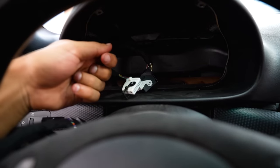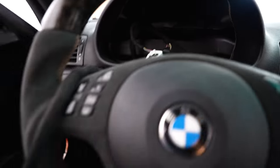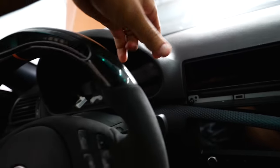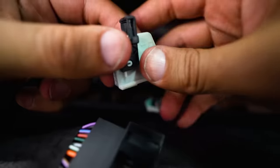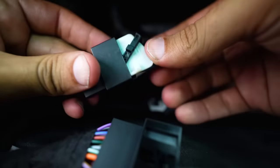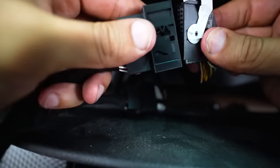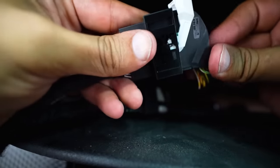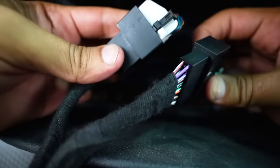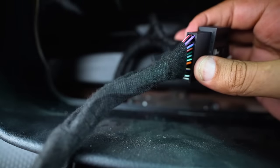It's fairly easy — it's bolted on top with two T20 screws. You fold the cluster down, pull it out just enough to get behind it, and remove the two connectors. Then adjust the steering wheel to make room, pull it out, bring it down, and wedge it off to the side. For the new cluster, the first connector goes in and locks into place. The second connector is very similar — you line it up and push it in until it locks. That's pretty much all you have to do; the rest happens on the digital cluster side.